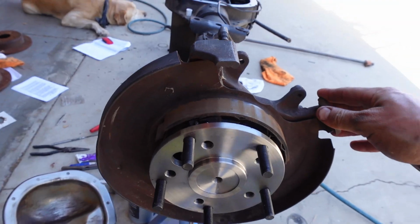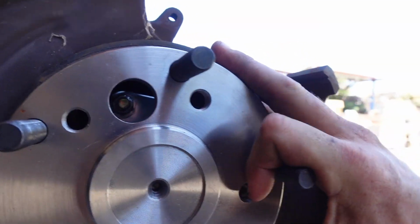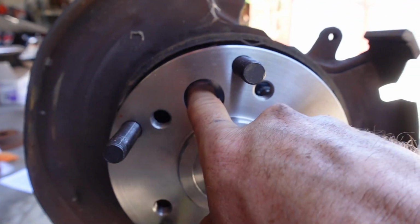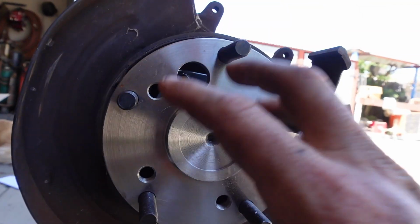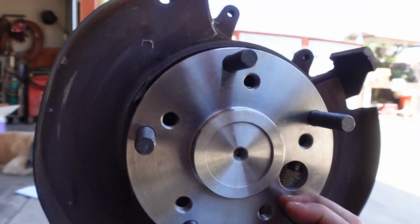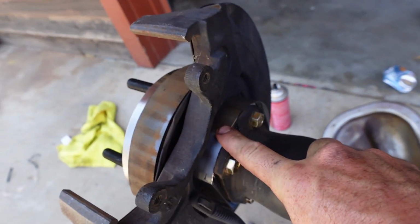All right, so when you're installing these axles, they give you a little hole here. And what's great about the hole is you can access the bolt. This is the C-clip eliminator. There's 1, 2, 3, 4. So you gotta go ahead and tighten that in and make sure they're firmly tightened in on both sides. Remember, we added this when we cut off the axle housing.